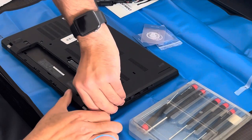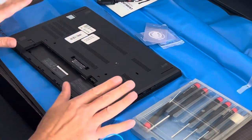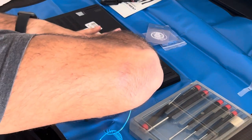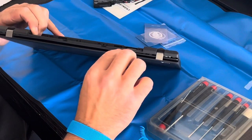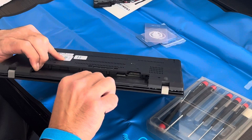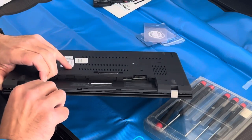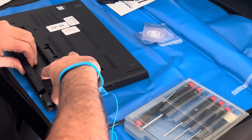So I've undone the screws. I like reaching underneath where the battery enclosure is and lifting from there first, then using leverage between that surface and the outer shell to pull up. I place the pry tool in between and rotate to get the opening. The T470 needs to be opened from the back side — if you try from the front you're going to break things. This one has never been opened before, I can tell, because once you open them a couple of times the connectors get a little looser and easier to deal with. I just work my way around, and then once you get to the front you just lift out.